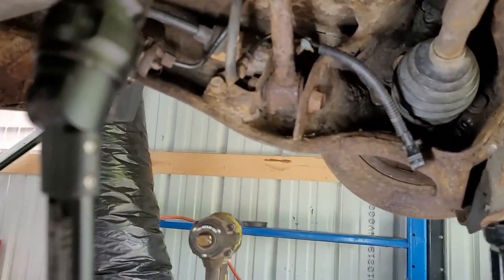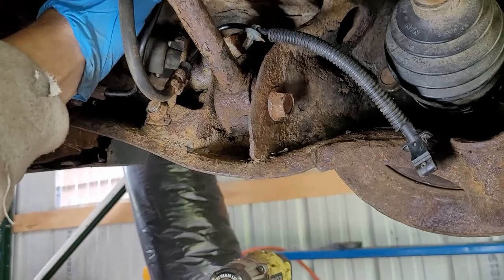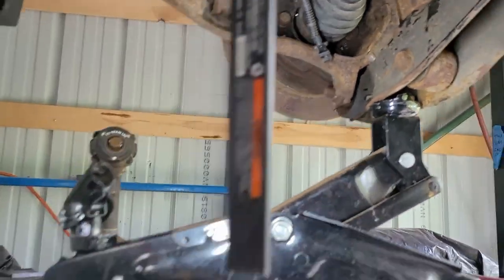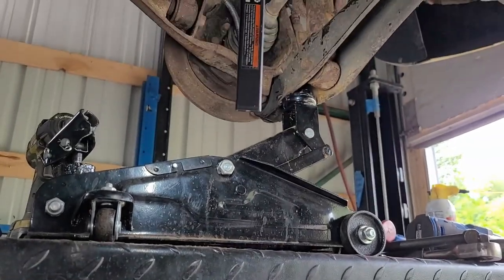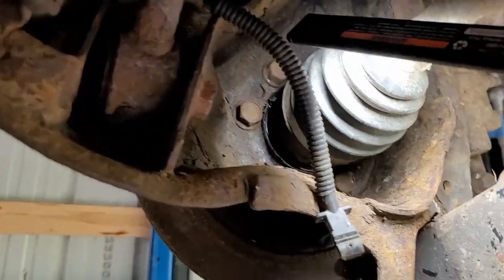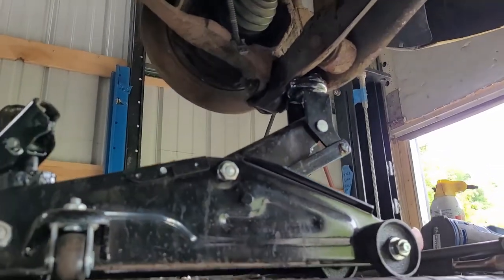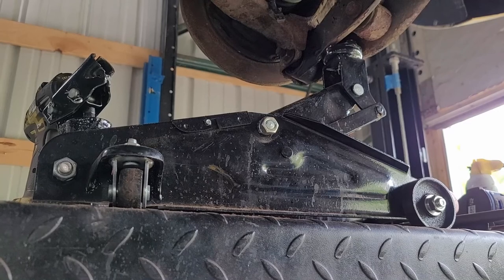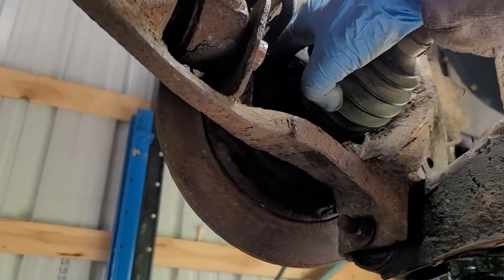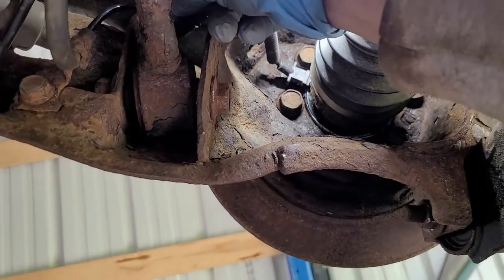I've got the drive shaft and now I'm going to get the drag link back on. There's a bolt here holding your brake line through this little holder. This cable right here has to go in - you can see inside there's a little clip on top and it's going to slide in and lock. This cable is the whole reason for this whole job - your bearing is good but that clip was not. She's in there now, took a little bit to get it in.